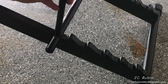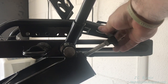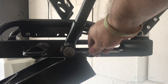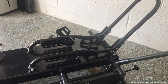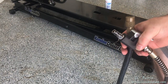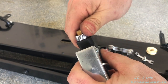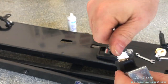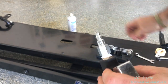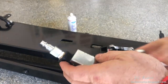About a minute later in this video I found the retractable handle on the safety bar. I found I had to tighten this handle because on release it would just spin right off. We're going to lower the lift and try raising it with the pneumatic pump. It did not come with the same size fitting as my other pneumatic air tools, so I changed out the fitting — the one it came with is held in with 9/16ths. I tighten in my fitting with some PTFE, a male-to-male adapter brass fitting, followed by more Teflon tape and a new adapter. It's possible the fittings for your pneumatic tools will vary from mine — you might not need this modification.